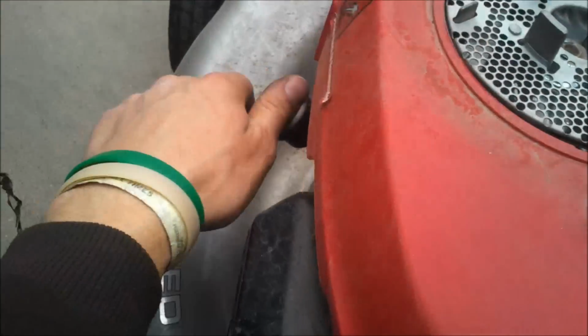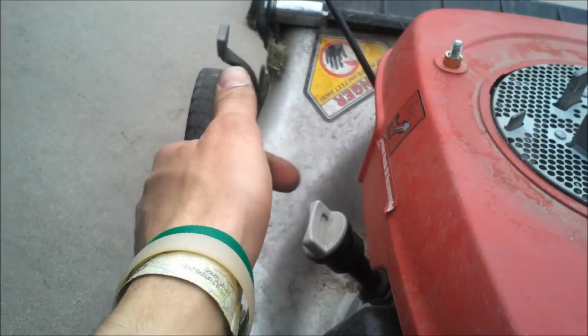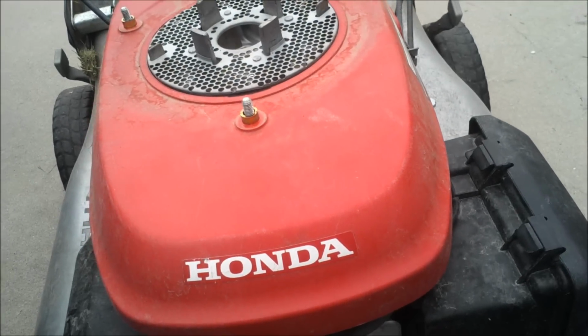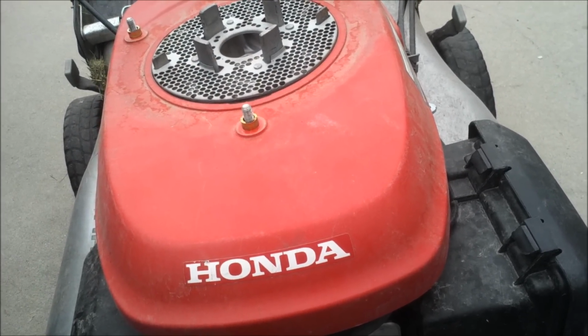Definitely change the oil in it. Holy crap, I'm gonna have to change the oil. It is nothing but black. And you see shoes. Look, it's like pure black. I have not seen that dark oil in an engine in a long time, and the engine still be in good condition. So definitely gonna have to start it up, let the engine warm up a lot, and get that changed out.